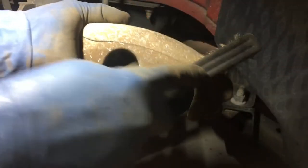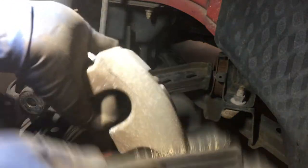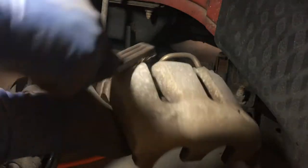To start, use a brass bristled brush to get the first layer of brake dust and oxidation off of the caliper. This caliper is off my 2006 Mustang, so there's 12 years worth of this stuff on there. Be sure to wear a dust mask or a respirator since there will be a lot of brake dust and rust being loosened and lifting up into the air, and you don't want to breathe this stuff.